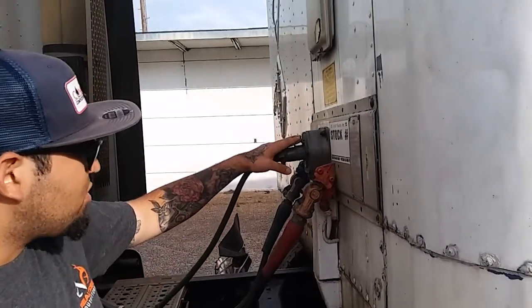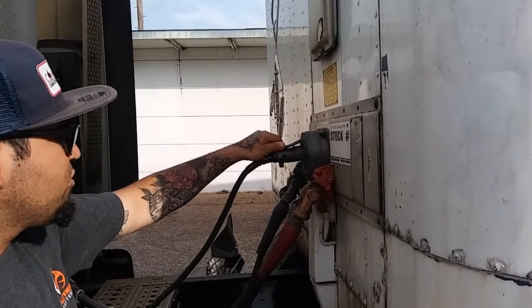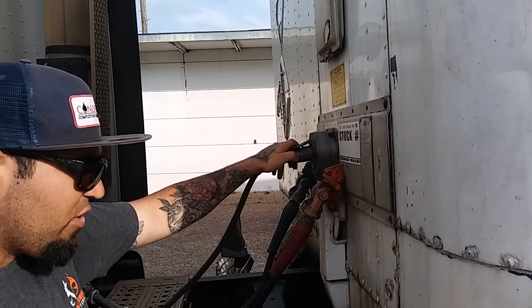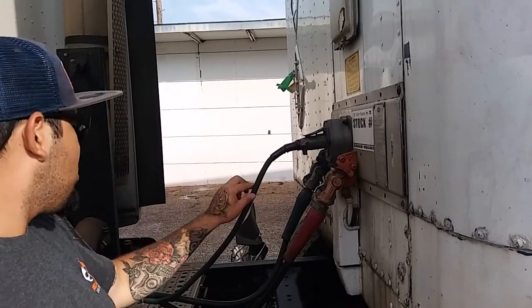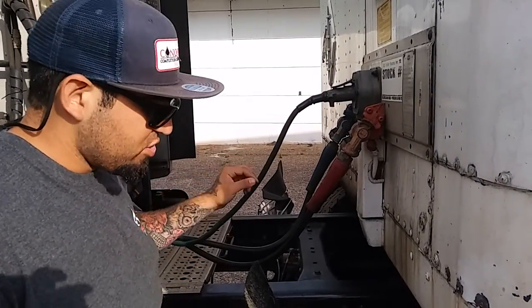My 7-point electrical harness is properly mounted and secure with the safety latch. I'll remove the safety latch and check the 7-point prongs on the inside for any debris or broken connections. I would also inspect the electrical line going to and from. Make sure there's no abrasion, bumps or cuts, and no wire showing.